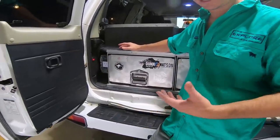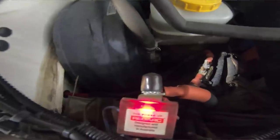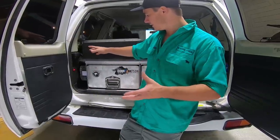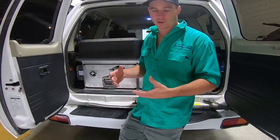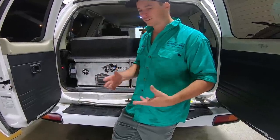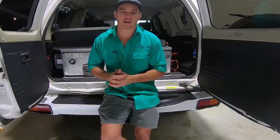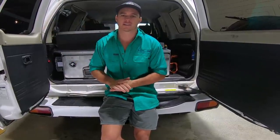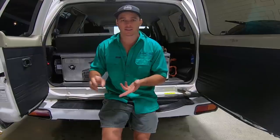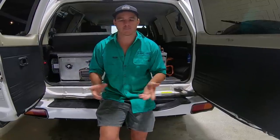All really basic and simple but clean and really effective. Under the bonnet I'm running a Redarc isolator which charges my secondary battery, and that's what the inverter and all these outputs run off. So while we're charging all of our camera equipment, we can never drain that main battery because we've got the Redarc system isolating those two batteries. That's a good little system if you're looking at a first car or a basic setup - Redarc isolator, Redarc inverter, and a couple of power outlets in the back. You can run your fridge, charge your gear - happy days.